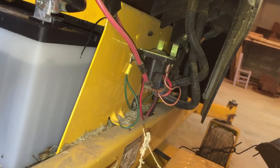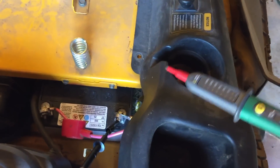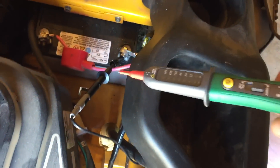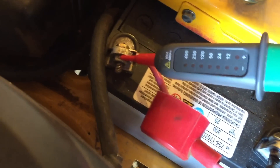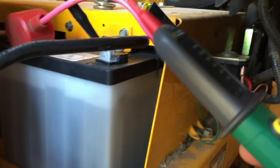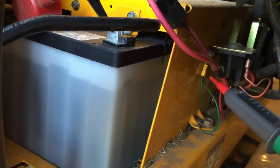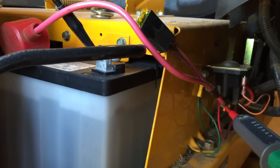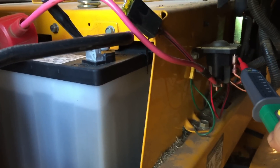You can look under here and see the solenoid sitting right there. I have a multimeter, but it's hard to work with sometimes when I just want to see if voltage is actually occurring in a certain area. So I've got this test light — it has a negative lead that I've attached to the ground on my mower, and whenever I touch it to anything that has voltage, it lights up. That shows 12-plus volts on the battery, so we know the test light's working. Now we want to test where continuity stops in our system. Power comes from the positive battery terminal and runs down to the solenoid — when I touch it to the solenoid, I still have 12 volts, so the cable is good, the fuse is good, and the solenoid is getting power.